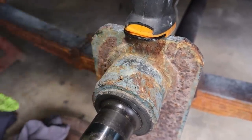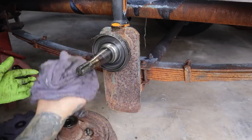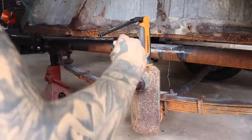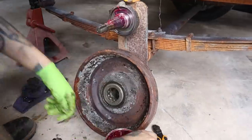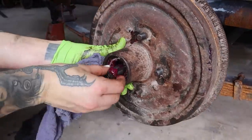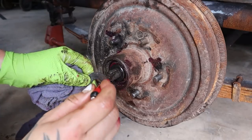Look at more of this crappy welding. I'm just going to clean stuff and observe. Look at that weird rust that's in this grease. I don't really have any replacement parts for these wheel bearings on hand — it's a Saturday morning and I'm going to meet up with Danny in about an hour — so I'm just going to clean, inspect, and tighten these up a little bit for now. If anything else needs addressing later I'll handle it then. This washer — I need to go home and figure out if I've got anything like this. You see that ridge right there? This washer should have a notch in it that'll sit in that ridge so it doesn't turn. This one does not have that.